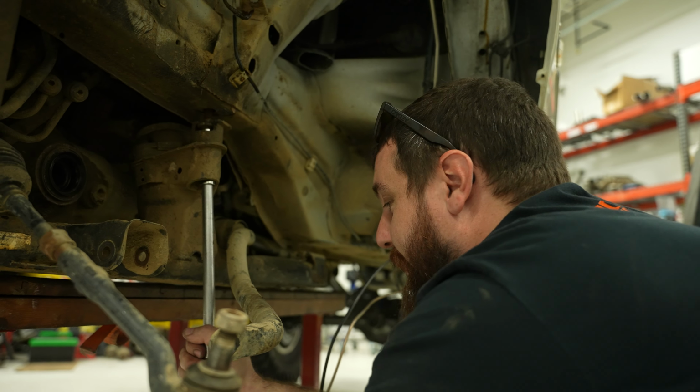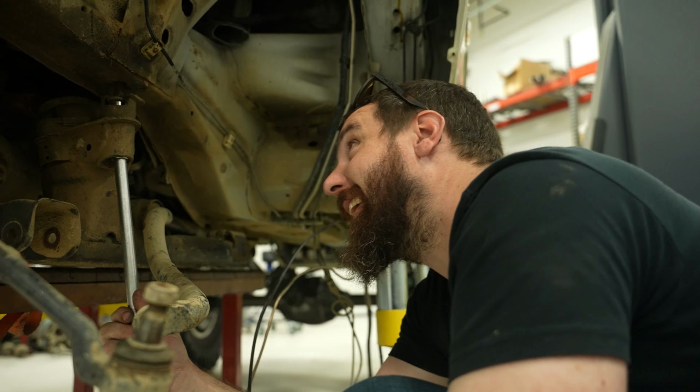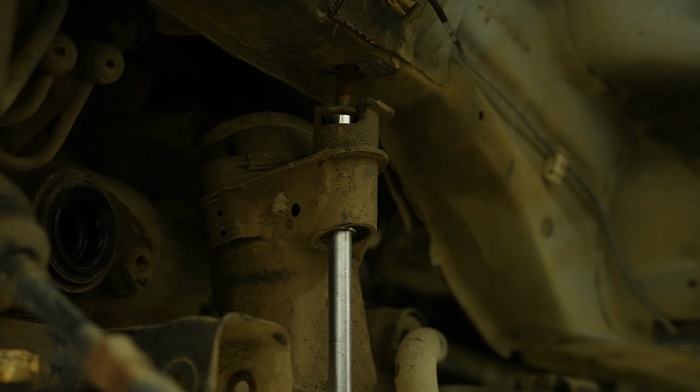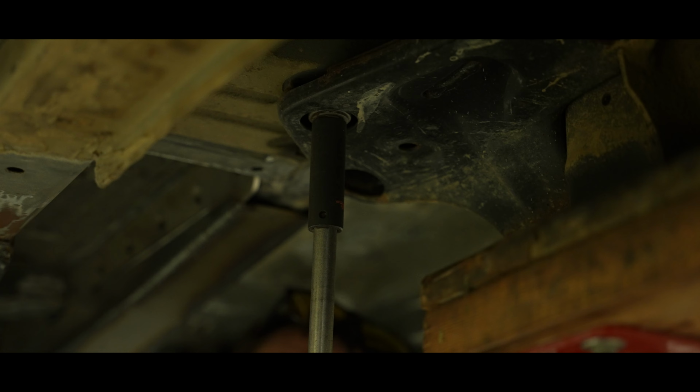Of course there's more coolant. But why wouldn't there be more coolant? I even did the block drain. Because there's more coolant. There we go. Yeah, if you're actually pulling a motor and you don't want coolant dumped in your shoe every time you move it, find the block drain. There's always one somewhere. These V8s, it's the passenger side on the side, a little above the starter. There's a drain plug there.